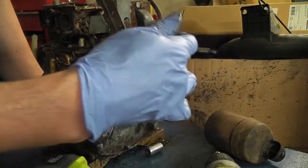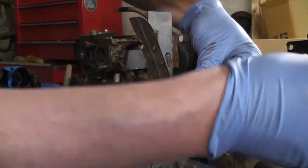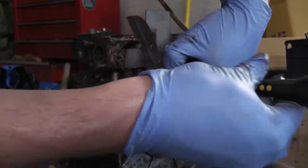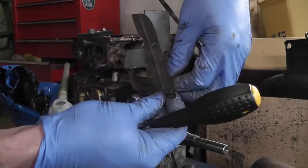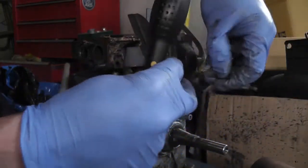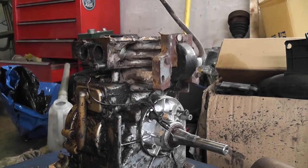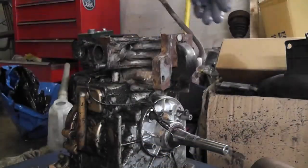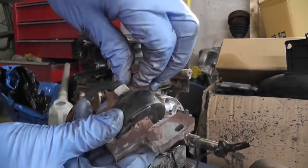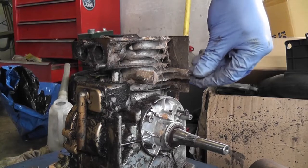Now we need to take off the magneto itself. There's a Phillips head screw here which also holds on the vane for the governor. I have to say one thing I'm really enjoying about this project is how easily everything is coming apart - though I shouldn't say that at this early stage because I might have just jinxed myself. There's the air vane - that's a separate little assembly in itself. There's a bolt here that gets removed as well, and that removes the magneto. The holes are slotted because you actually have to set the air gap on the magneto. There's a bonding strap on it as well.